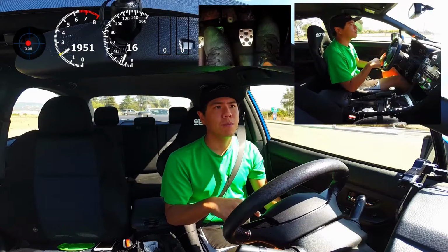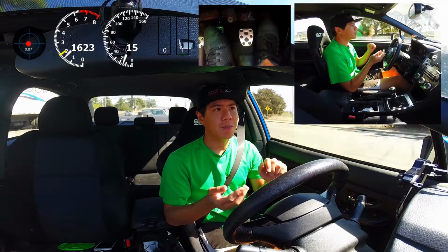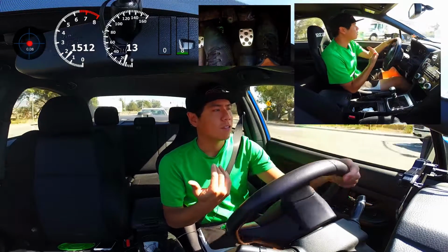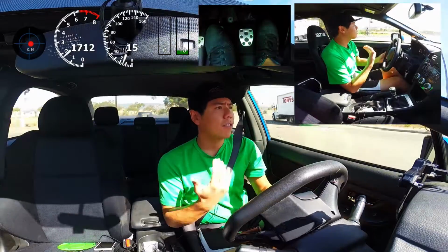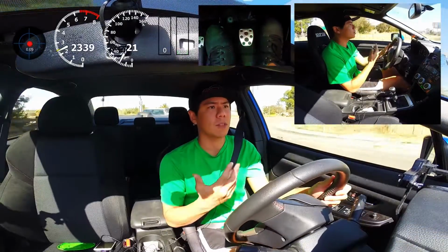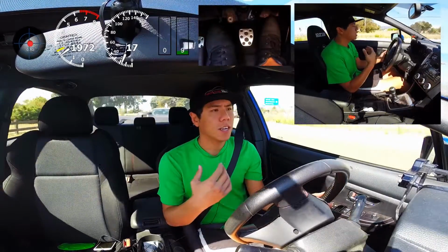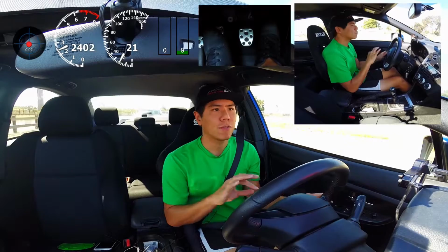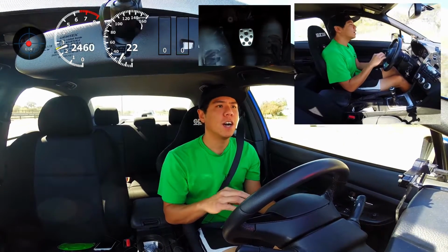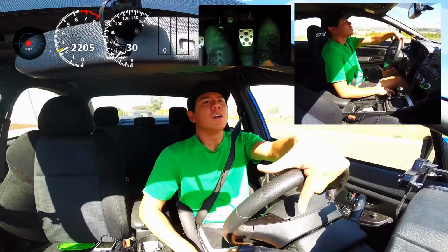So hopefully when I review the footage, you can see that maybe 3/4 of the way my foot comes off quickly, and at the last quarter of the way, it's a little bit of a slower release to let the transmission spin up, so I'm not jerking the car. I think that's one aspect of heel toe that most videos miss, is the clutch control.